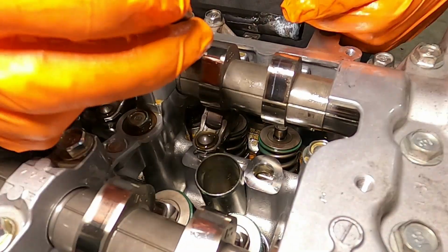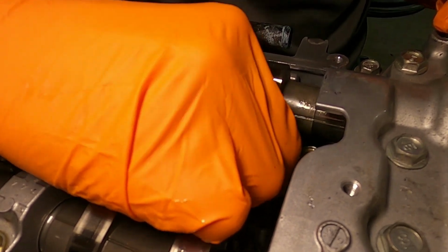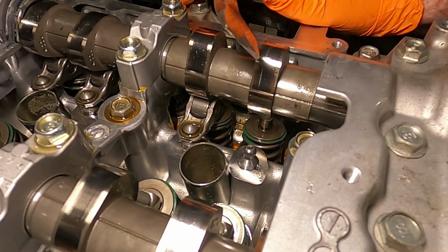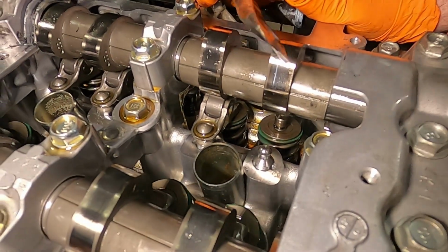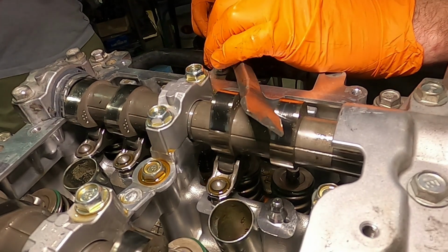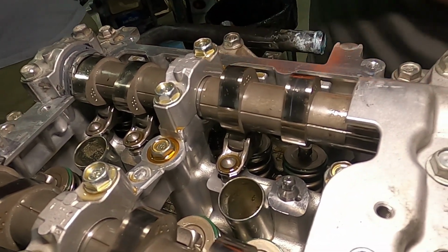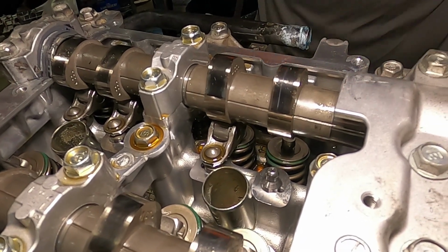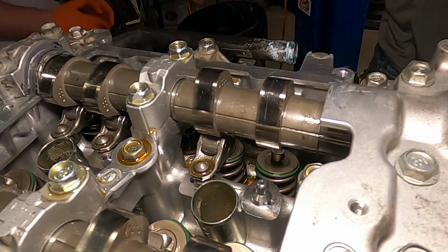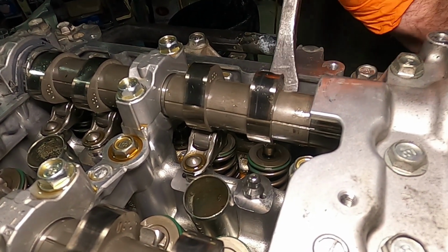Oh, yeah, those are ready in, and this is what goes in, a new push rod. And also I have this pry bar ground out so I don't dig up the valve tip, so that I can grab the very edge of the valve keeper and the valve keeper doesn't go flying and drop the valve when I push down on it. Some 5-head shit right there. I've been accused of worse.